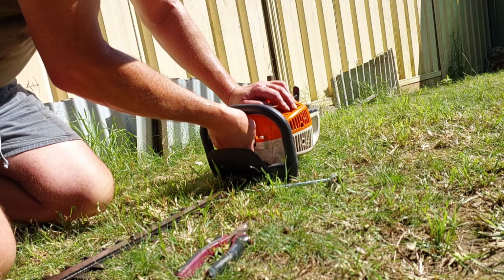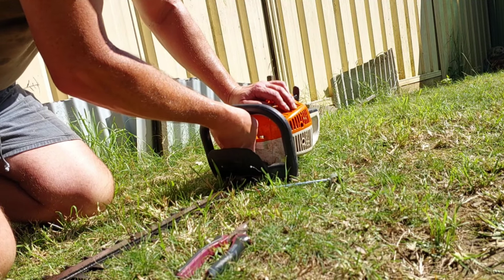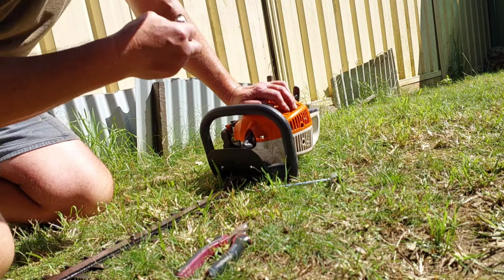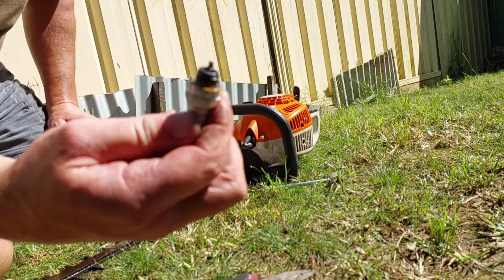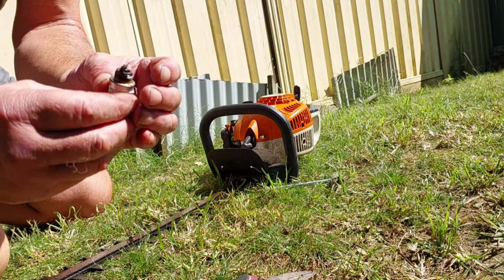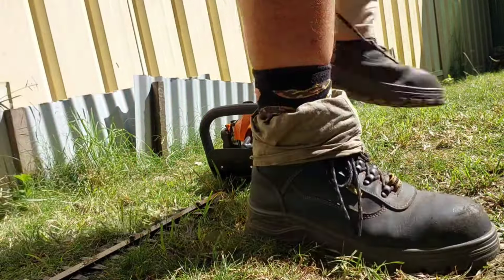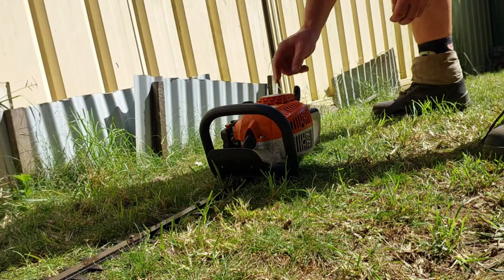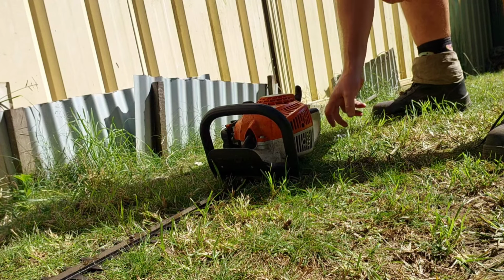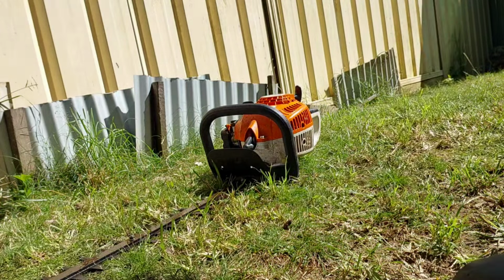Right, come on. These ones have never been out. This is wet. Wet, wet, wet. Okay. Not fouling or anything like that, not carboned up, just wet. So I wondered if you actually got spark. I'll turn the ignition off because I don't want spark jumping from there into a pool. Now that should have blown all the fuel out. I'll clean this carby up and I'll screw it back in until it's just right.